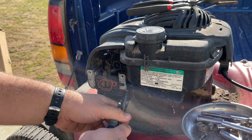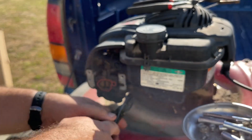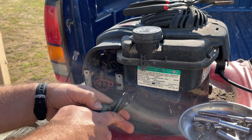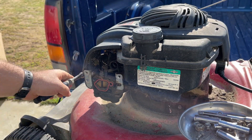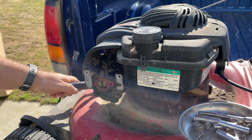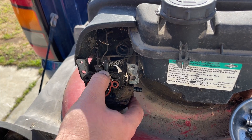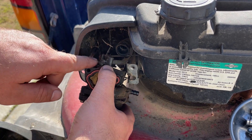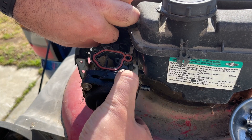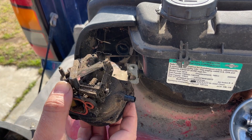At this point, all we have to do is angle up this clamp here, pull that back. There's no fuel in the tank, so we don't need to worry about a pair of line pliers. Carburetor is ready for removal — very carefully. This one is stuck on there. So we've got to remove the automatic choke linkage here, and with that you can normally have enough slack to pull it off. You're just going to rotate the carburetor just like that. See you guys at the workbench.